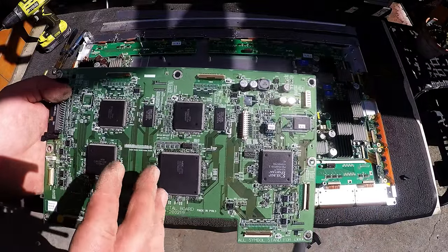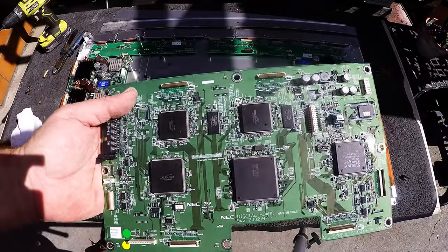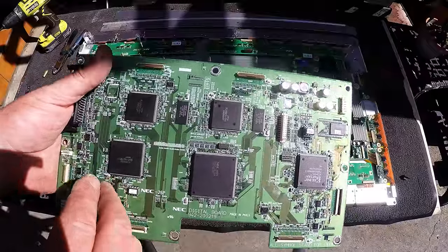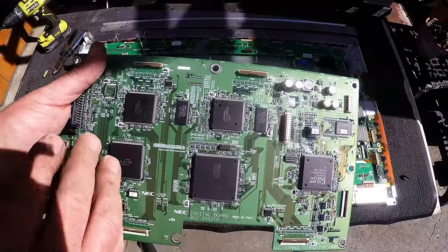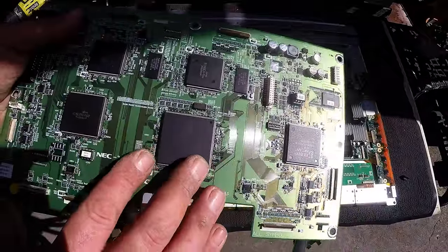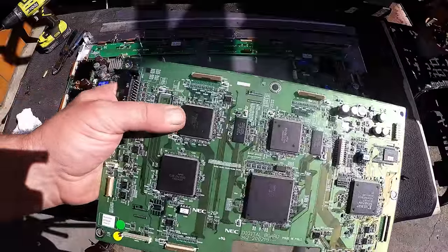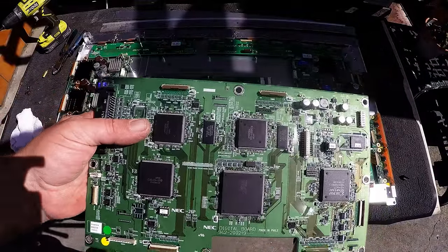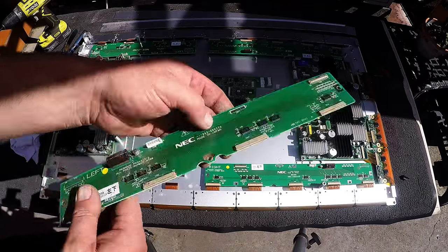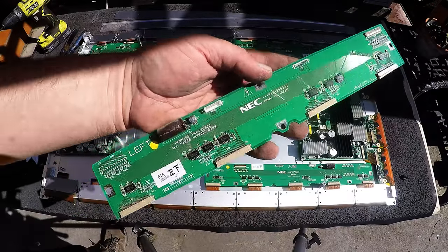This is just the main board - just a mid-grade board. Some people call them peripheral boards, but it's basically just a mid-grade board because it doesn't have any high-grade chips on it, like gold corner chips. But these flat packs are all very large, so you're going to get good value out of them. You might be better off depopulating a board like this rather than selling it as mid-grade, but it's up to you. And just these strip boards - they're like a no-grade, you can just throw them in with power boards.